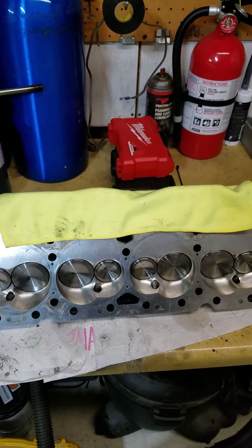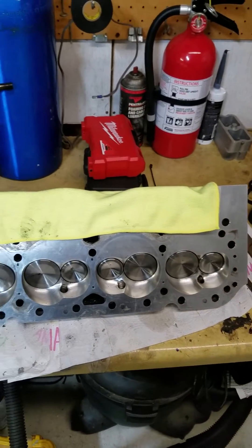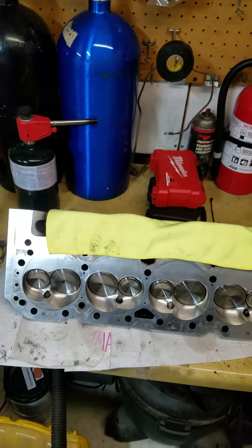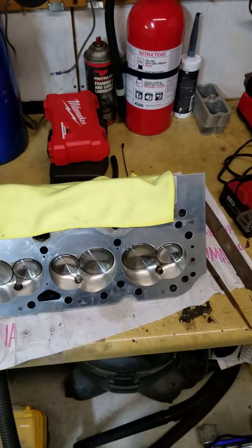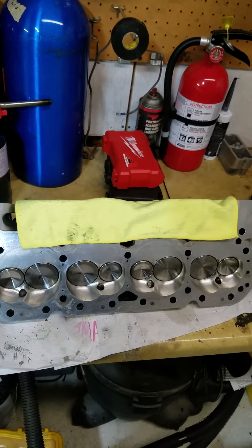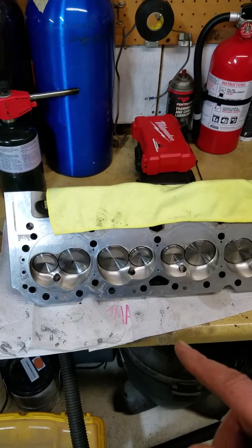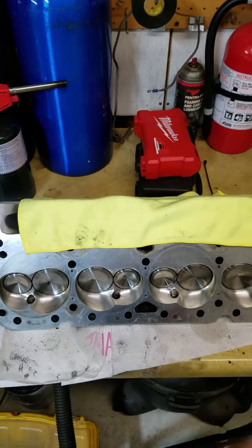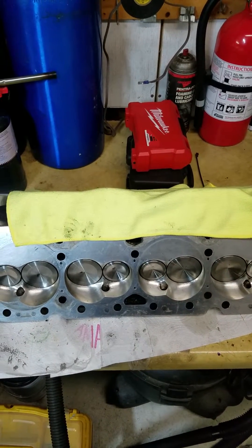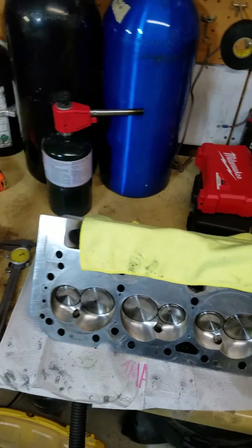Just some tips and tricks on that. It was an experience — a little less room for error than what I expected. I used plenty of WD-40. On the first cylinder head I went through three drill bits from not using enough lubricant. This second cylinder head, I used the same drill bit for all six holes. Definitely use plenty of tapping oil, drilling oil, or WD-40 — it definitely seemed to help.